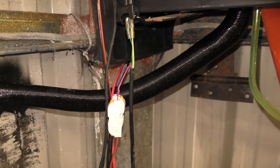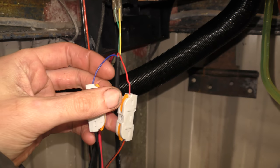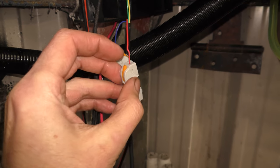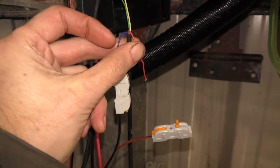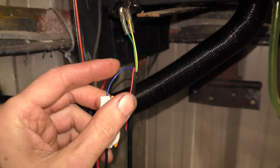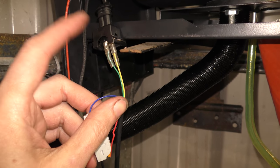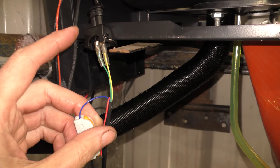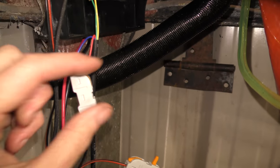This is David from the future. In the video I'm going to explain that there's four wires here, but in the newest version of this setup there's only three wires - the red wire is omitted, you do not require it to be connected. It'll be taped up in your loom, just hiding inside. You only need a ground connection and the two pump connections. The silent pump will get its positive feed from the pump connections, meaning that when the heater's off, the circuit boards inside the pump do not draw any power. No red wire, just three wires.